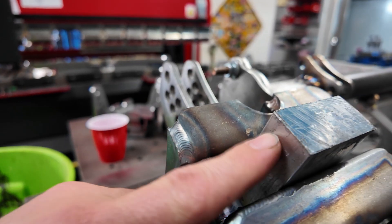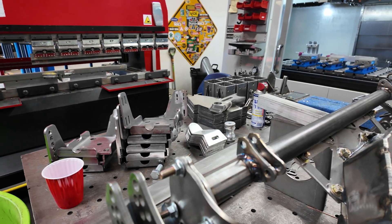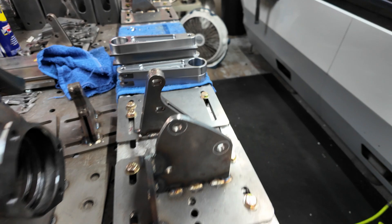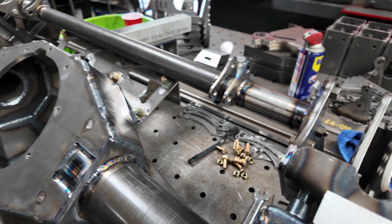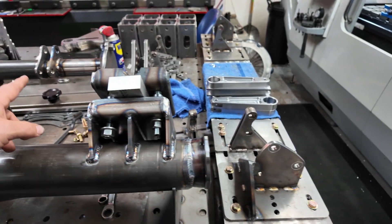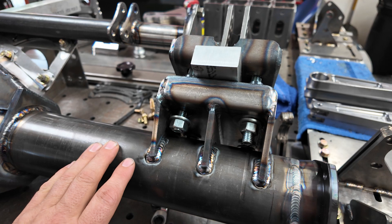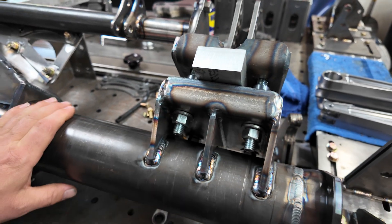I made these little aluminum spacers that represent the leaf spring, so I can put the entire crossmember together. I have this cool fixture right here for making these crossmembers. I made the crossmember from all my specs, and we went ahead and made master crossmembers for all of our stuff too. I put the master in the jig and made some crossmembers.